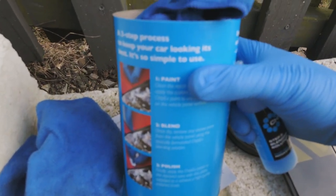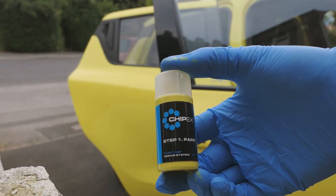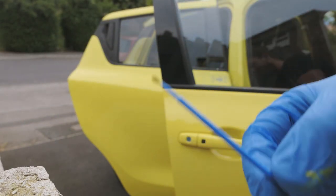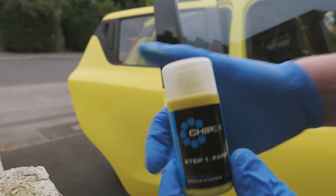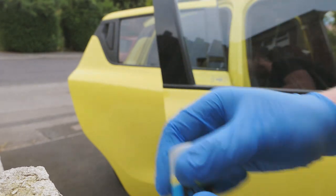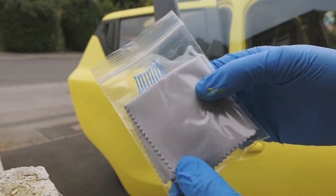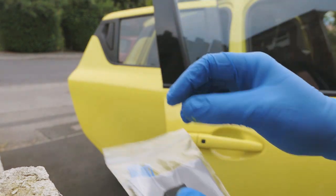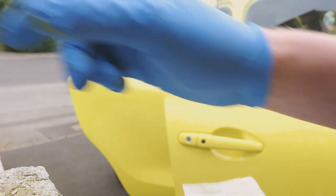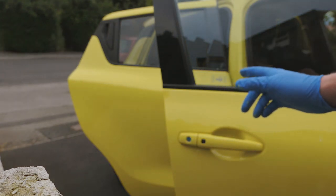The next step is to apply paint — step one. Once we've cleaned the repair areas, we move on to the paint. I've gone around the entire car dabbing the little stone chips with this little thing here — it's like a little furry cotton bud but really, really tiny. I've shaken the paint well before applying it. Now you've got to use this little foam block and a little silk cloth, wrapping it around as you would do for a ceramic coat, and really gently glide over with the step two blending solution. That way it takes off the minimum amount of paint, nice and flat and level, so you get the right finish and don't remove too much paint.